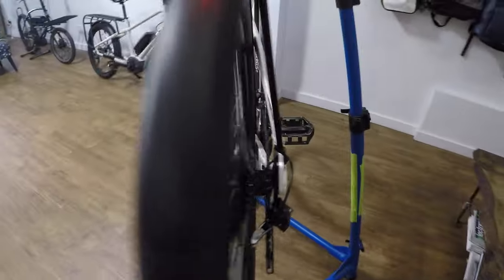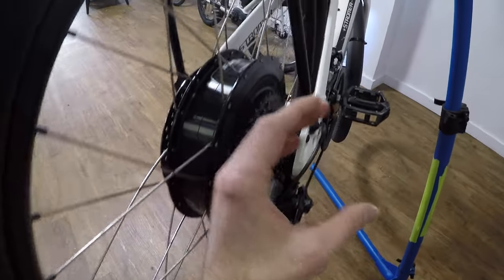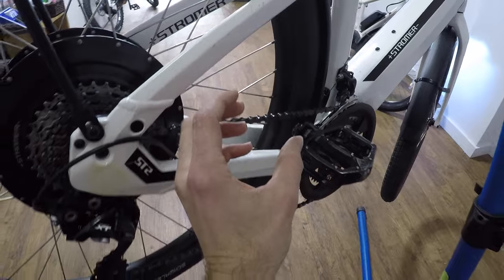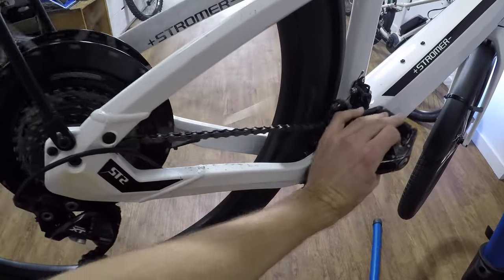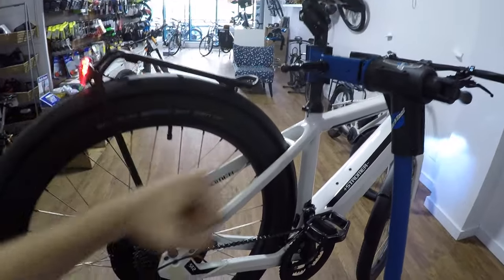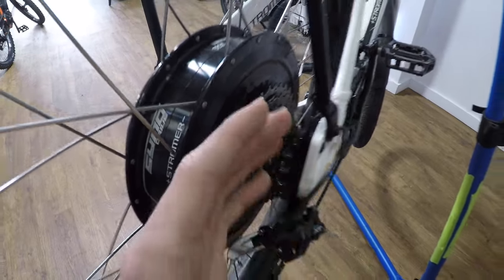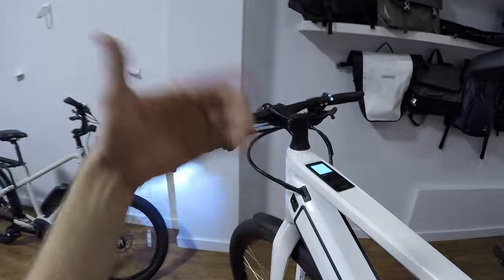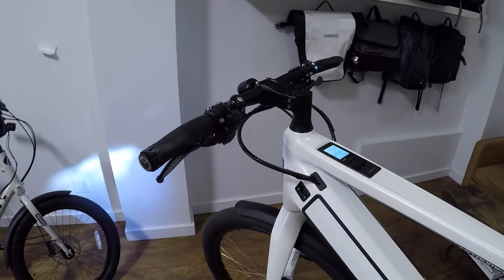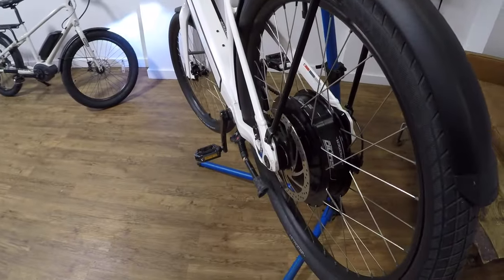If you come back here, you can see this little plate — it's a metal plate right there. That's a strain gauge. As the chain tension increases as you're pedaling — maybe the weight of your body is on this bike and you're going up a hill — that chain is going to strain this piece of metal. That actually sends some feedback, and you get assistance that's roughly proportional to how much energy you're exerting. And as soon as you stop, the tension reduces and the motor stops.